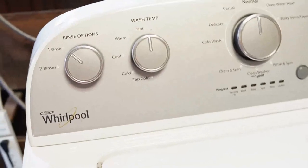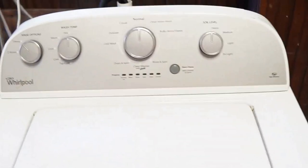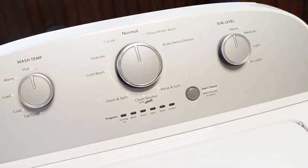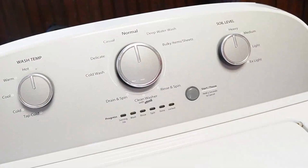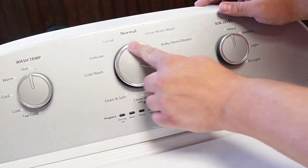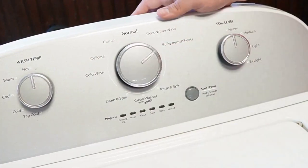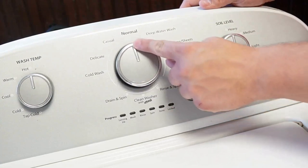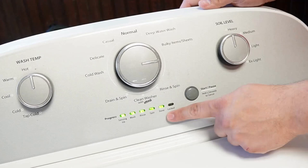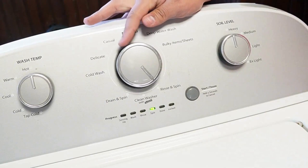This is the first type of reset, which should restore your washing machine to all default modes and settings. Now let's go ahead and attempt to recalibrate this washing machine through the calibration mode. This is a must-do if you've installed any new parts on the washing machine, from a board to a balancing rod. With the washing machine freshly rebooted, rotate the dial again counterclockwise 360 degrees. Then turn the knob right three clicks, left once, then right once again. It should be pointed at three o'clock or all the way to the right position. You need to do all these things within three seconds, and it may take a few attempts. If you've done this right, all the lights at the bottom of the washing machine control should flash on and off, showing that you've entered into the diagnostic mode.